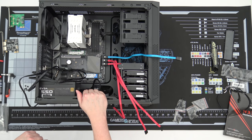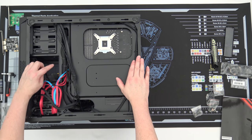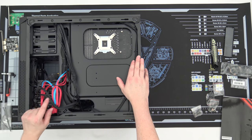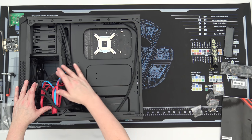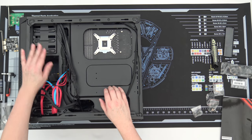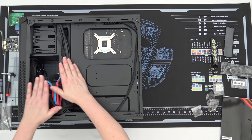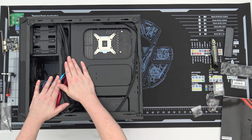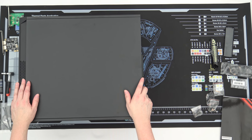Welcome back — there was a large cut while we worked on cables and got a cable extension and a splitter. We've got the SATA cables from the power supply plugged into the four drives in the back. The red and blue SATA cables from the motherboard are powering the four drives back here. The add-in card will power the four SSDs, and there's a single black SATA cable for the Blu-ray drive. I've done a little bit of zip-tying — it's not the prettiest cable management I've ever done.